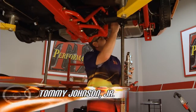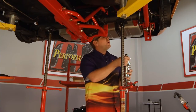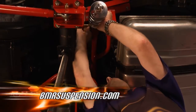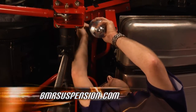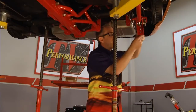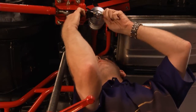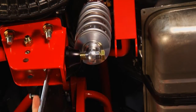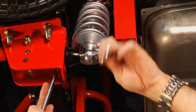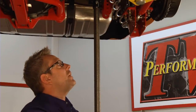Now that we've got our crossmember mounted in, it has the location where we're going to mount our shocks. Coilovers are going to give us a lot more adjustability — we can adjust the ride height, control the rebound. There are a lot of neat things we can adjust to get the ride everybody's looking for. Alright, got my shocks on — let's see how Kathy's going.